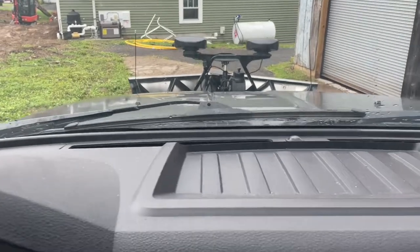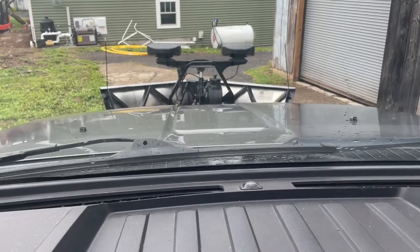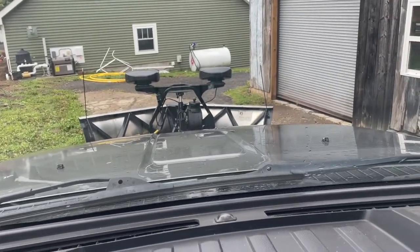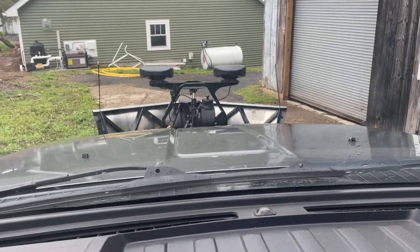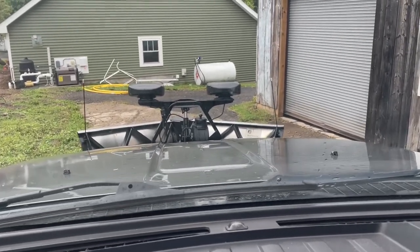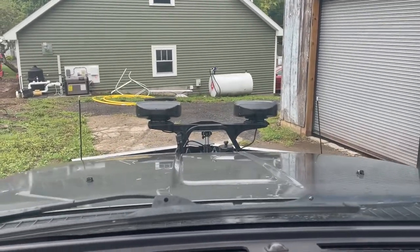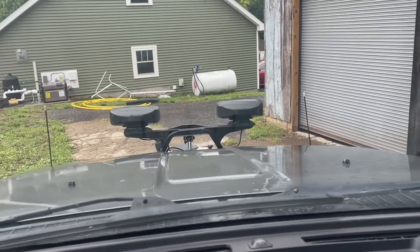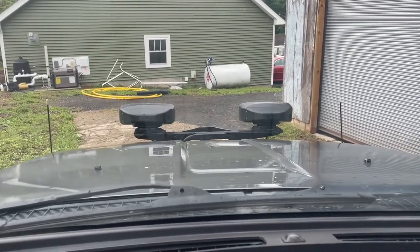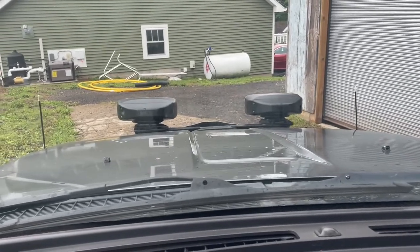In order to mount the plow, you see the two lines in the middle of the hood. The way I've found to do it is those two lines actually line up right in between those two lights. I'm just going to drive forward here — nice and straight — and you can watch until the plow starts to move. I can tell I'm getting close enough, which means I'm probably in. See, the plow moved.